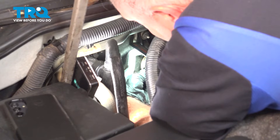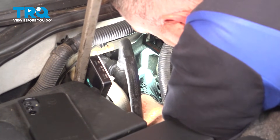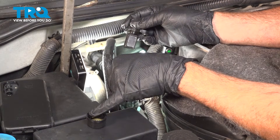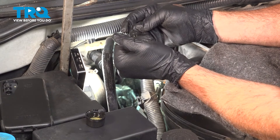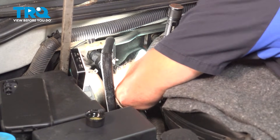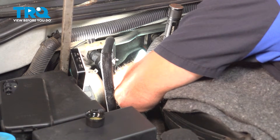Using pliers because the connector is a little bit stuck, apply a little bit of pressure on the lock tab and that'll push in, and then the sensor should walk right out. Go ahead and pull that sensor out. Before installing, put a little bit of engine oil on your finger and rub it on the O-ring — it's going to help the O-ring slide into the engine a little bit easier. Reach the sensor down and around and connect it to the wiring harness. Once you line that up and push the sensor on far enough, the clip will auto-lock and pop back into place, securing that sensor.